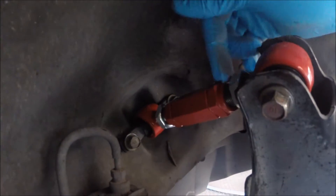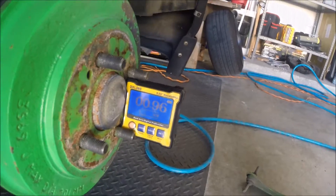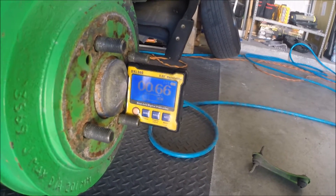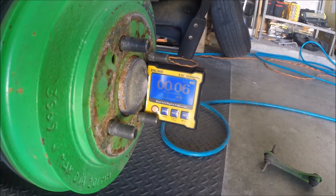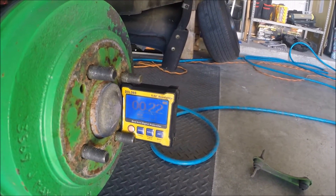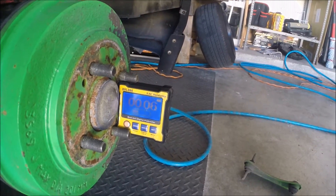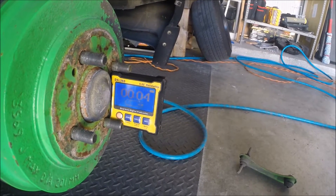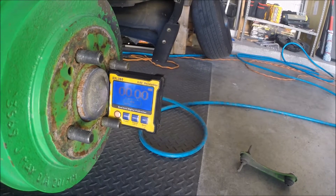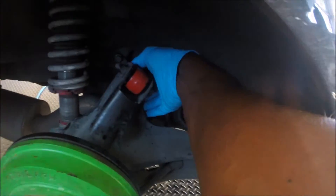Now I'm showing how I'm using the protractor since I bought it. I'll loosen the bolts in the back — this one right here and this one right here. Now all I'm using is this middle part. I'm gonna turn it backwards and you can see it moving. I'm trying to zero it out or put it a little bit forward, because when you drop the vehicle the wheels tuck in. If I put it at zero it'll be perfect, but when I drop the vehicle it'll still turn in more. Getting it exactly at zero — there we go, just by turning it backwards or forwards with my fingers.